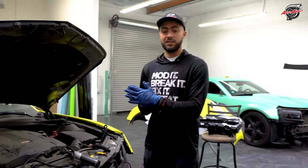All right, for the headlights, guys, we're not adding any external harnesses to this. Remember, we're not gonna do anything. Whatever that we give you guys need to go in there, but this is another firm one too. So when it goes in, you guys are gonna think that it's in there, but it's not. It will also pop a fuse. So you gotta kind of hold the headlight in a very good position and clip it in there. You hear that clip? The second you hear that clip, it's good to go without any issues, and you got yourself a full-on T-harness conversion with the headlight conversion ready to go to function on your 10 to 13 Camaro.